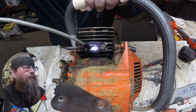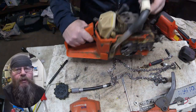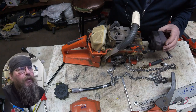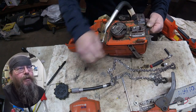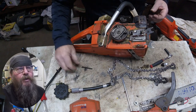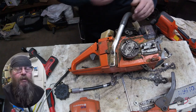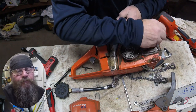It's scored. The piston took the brunt of the damage — I couldn't see a lot of cylinder damage, so this might have the potential for just a piston replacement. The way it was really deeply scored in that one spot — I have seen guys take the spark plug out, put a screwdriver through the spark plug hole into the exhaust port as a piston stop, and had problems because they put a ding in the cylinder that stood a little proud and the piston caught it. I'm not saying that's what happened here, but it looked like that.